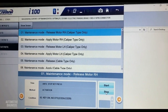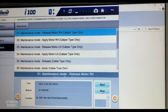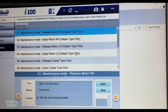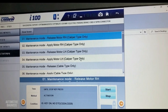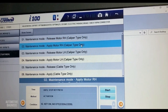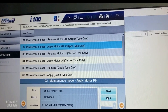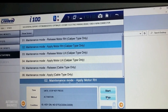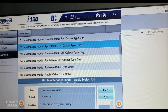I can hear the actuator on the rear right already operated — it's ready for pushing back the piston and replacing the brake pads. After replacement, you do the same for the left side. On some models there's one option for both rear wheels rather than doing them one by one. After changing the brake pads, you just select 'Apply' and press OK. I can hear the actuator operation — that's it. This releases or applies the parking brake to give you room to push the piston back when replacing the rear brake pads.